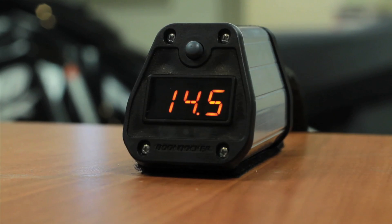What we mean by the TPS Smart EBC is that it uses a throttle position input to control boost. For example, at 30% throttle position you will get 30% of your set boost; at 70% throttle position you would get 70% of your set boost, and so on. This allows for proper fueling and smooth drivability at any throttle position — just another electronic advancement from Boondocker.